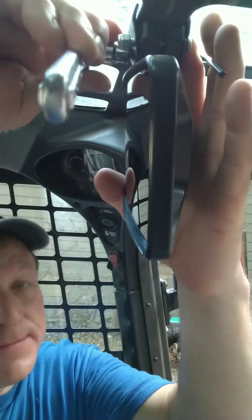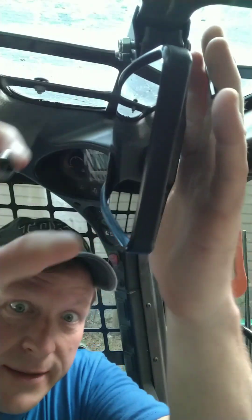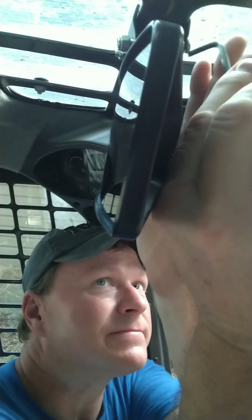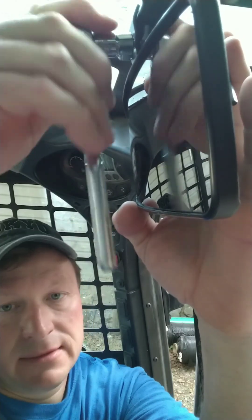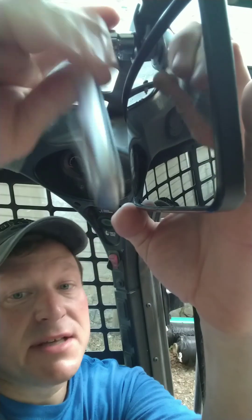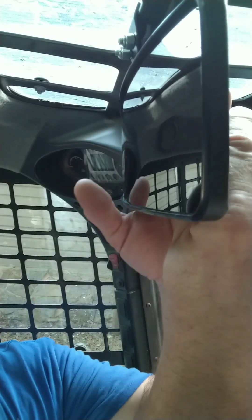Center your mirror up. It's going to be a little tight getting into this back corner — a long-handled Allen wrench would be a lot better for this installation. Now the tighter you tighten these nylon lock nuts, the tighter that ball socket gets, so you want to be very careful about how you tighten this. That seems about right.